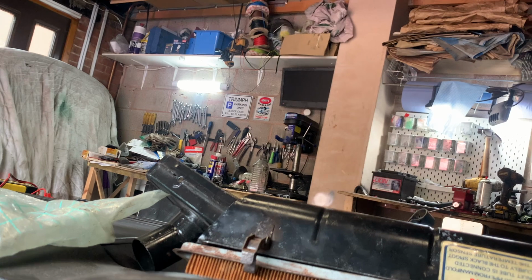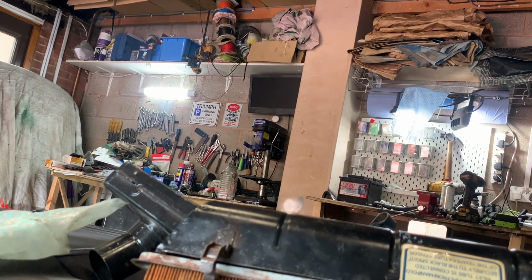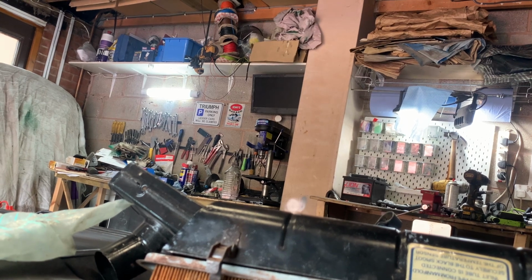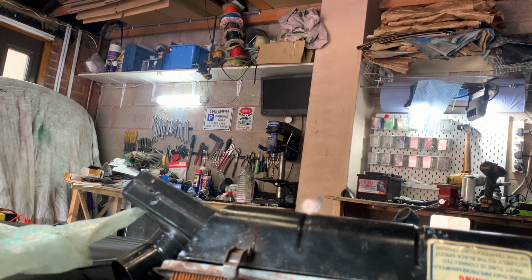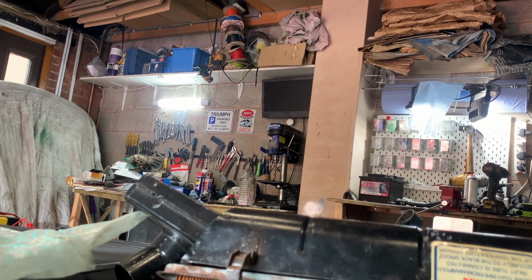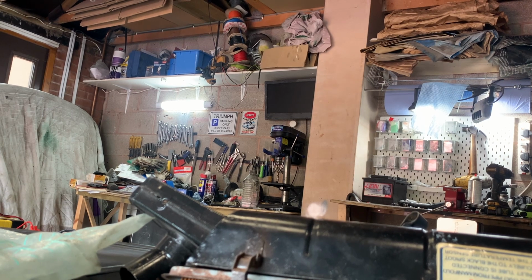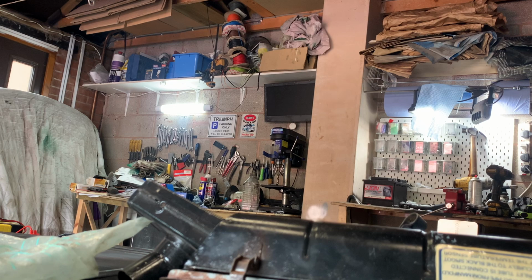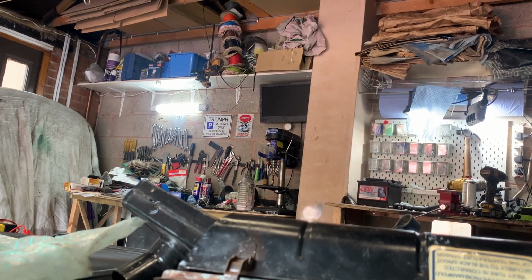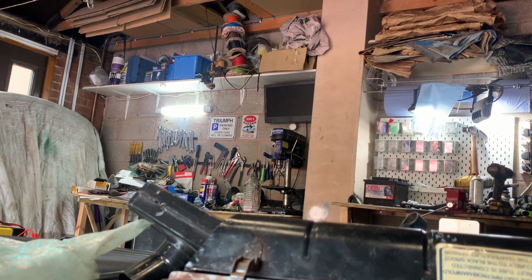Now I did have a couple of goes at trying to get it to start, just by cranking it, and nothing more, and I was doing all of this work in between, or afterwards whilst I was letting the battery recharge. It felt like maybe once, twice, right at the beginning of a set of turnings, it was wanting to catch, but if I was doing it for 10 seconds, it would be in the first couple of seconds, and after that it wouldn't try again.